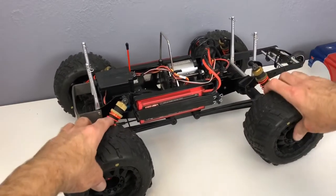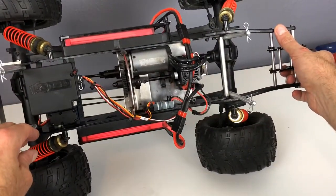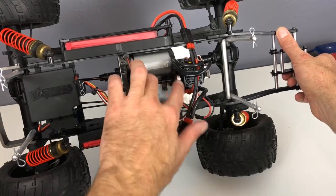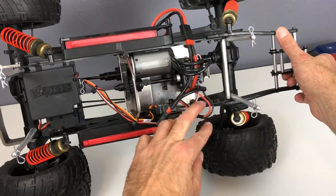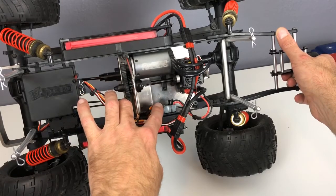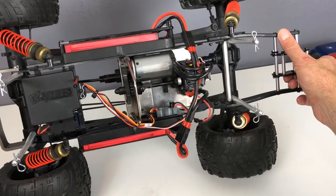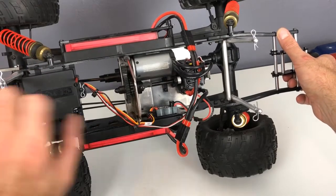You're going to hear that noise — these digital high torque servos are noisy. Basically, anytime any tension is put on them, they wince like that. It's normal, you're not hurting it. They're just constantly trying to recenter because it's a digital servo. I relocated the Vortex ESC to the back of the truck, giving myself a little more space. You can see the two power leads coming off the battery lines going right to the external BEC. This BEC is now going to the receiver and I've got the new servo installed. Right now the ESC is off — it's not even turned on. As soon as you plug the batteries in, that external BEC fires up and it's now powering the servo. It's nice and clean.